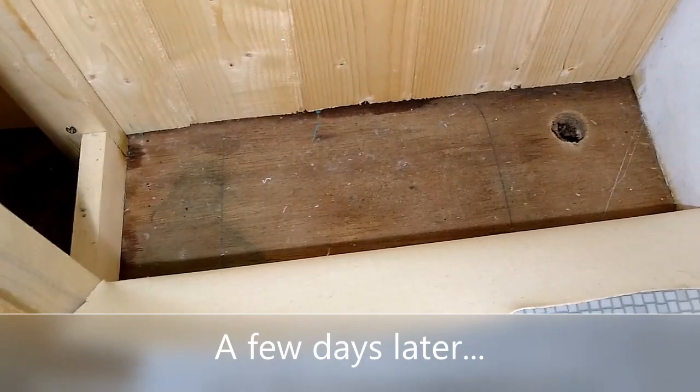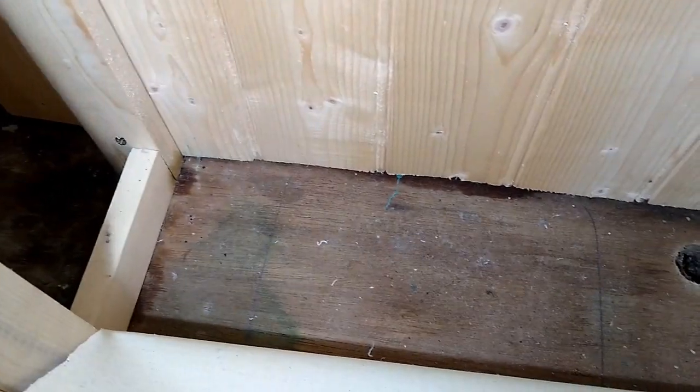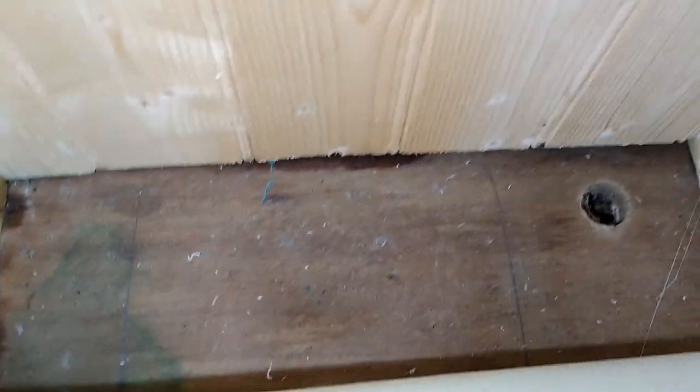What I might do is turn the water pump off during the day and just turn it on when I want to use the sink, and see if it dries out — process of elimination. Through careful experimentation I have found that it's definitely fresh water. When I run the water pump, dampness comes through. If the water pump is off it doesn't, and it's nothing to do with pouring water through the tap. So any grey water — if I don't use the sink but still have the water pump on — the damp patches come back.